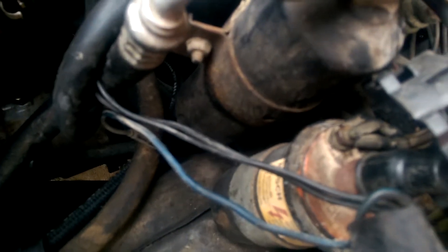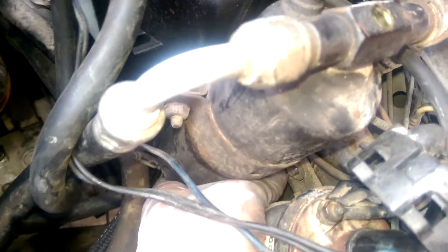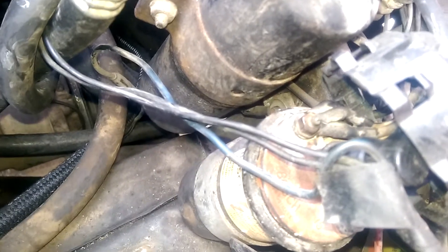As I get further into this ignition coil, I found that there's a ground down there. I'll jiggle it so you can see it better — that's part of the mounting bracket for the ignition coil. That's also really dirty, and it wasn't on very tight. I'm not sure what that goes to, but it doesn't really matter. It wasn't on very tight, so I'm sure that was causing some sort of short somewhere.